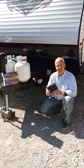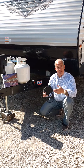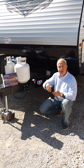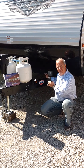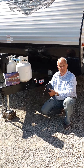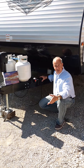Autobrake will work in any direction at any angle, so there's no need to have it mounted in the direction of travel — part of the beauty of it. This trailer here has a junction box in the front. Most people are electing to wire right into the junction box, so you'll match your wires up on the Autobrake to the wires on your trailer, and then you're ready to mount Autobrake on the frame or in the cabinet or wherever you're going to put it. In this case, I'm just going to show it mounted on the frame.